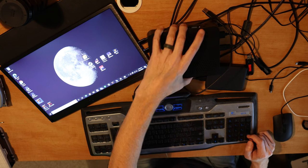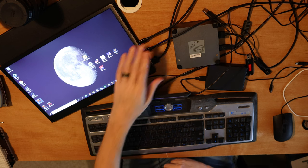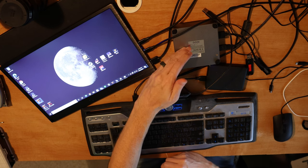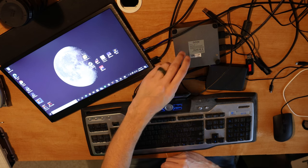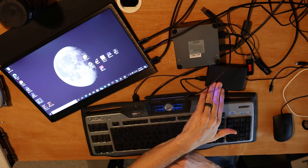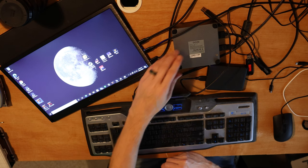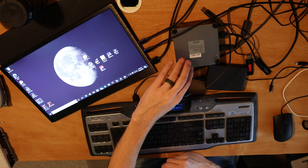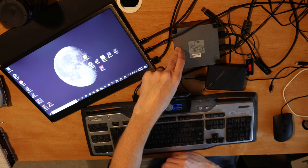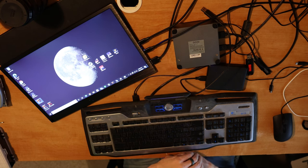At that point, we removed the Kodlix PC and we did the same thing. We connected up our True Image software USB to the Geek Plus, connected up our external drive where our backups were, and then we restored those drives. We restored the OS drive, the boot drive, to the M2 SSD, and the data store we restored to the SATA hard drive.